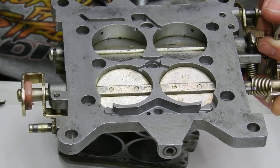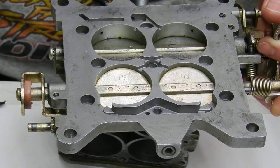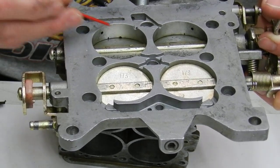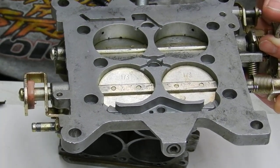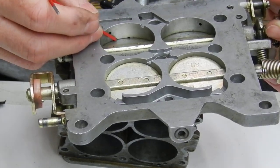When you're getting the engine hot and get the mixture and idle speed adjusted, let it cool off, take the carburetor back off, and check it again. If you're in that 35 to 65 thousandths on the transfer slot, you're good. If not, drill it a little bigger, and each time you're going to notice the throttle plate close up and that gap get a little smaller.